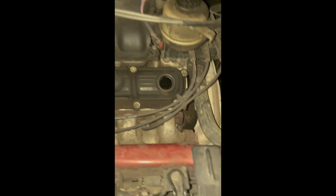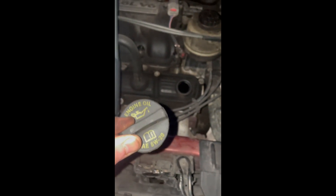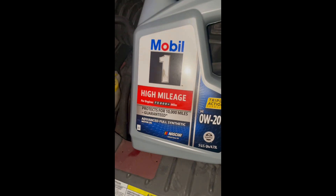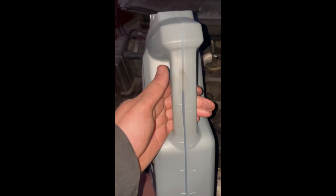The last step is to add the oil here, and this is where you'd want a funnel. The oil required is 5W-20; we're going to use 0W-20 — it's similar, it's going to work. We want to use about 4 quarts, and this container has 5 quarts.